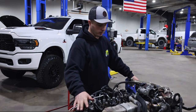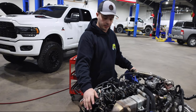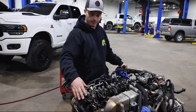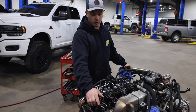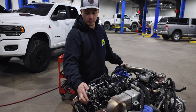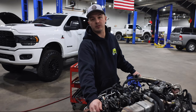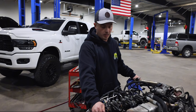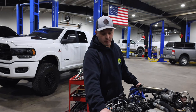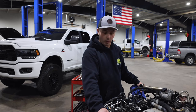All right, so we got the rockers all on. We got valve lash set at 10 and 20, 10 intake, 20 exhaust. We're pretty much ready to go. We put some oil on and pre-lubed everything. And talking about oil, you can go back to a traditional 15-40, granted you're in the proper climate for that type of oil. We're just going to stick with the suggestion of Cummins and suggest the Valvoline Premium Blue 15-40. There are all kinds of different oils. Just make sure of it, anything sold these days is good oil. Just change it frequently and you probably shouldn't have an issue.